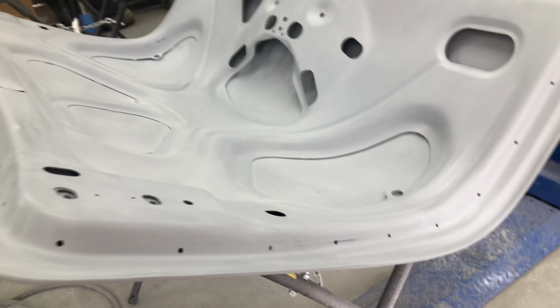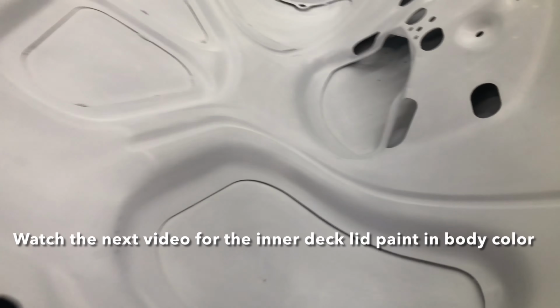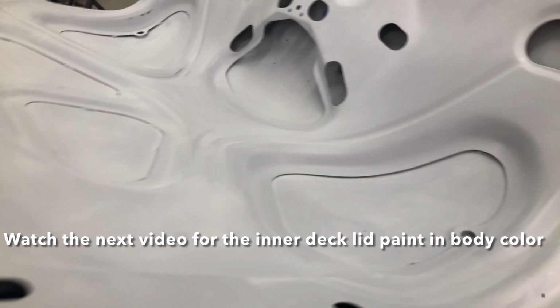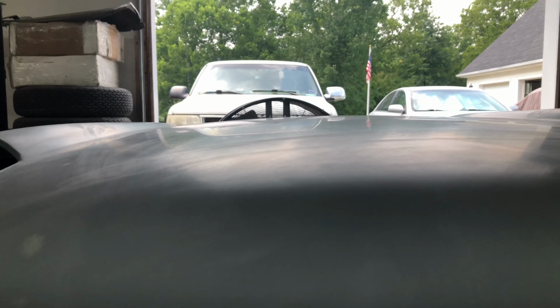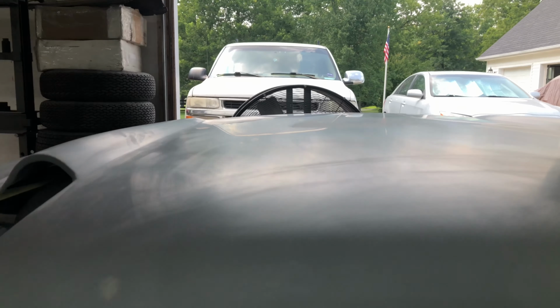Okay, Steve sanded 400, 600. That's ready for paint. Really, really nice, smooth. I didn't do much on this as far... well, sorry, I did, but I didn't film at all on it. But I have to just retouch up a few areas here where I broke through, like little areas like that. Just touch them up. But that's 400, 600. That's ready for paint too. So blow that off, but pretty damn straight, beautiful, nice and straight across there.